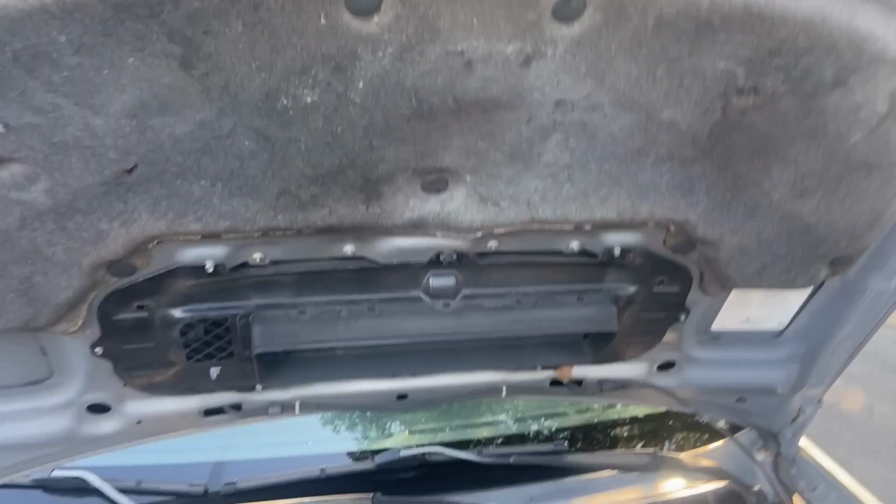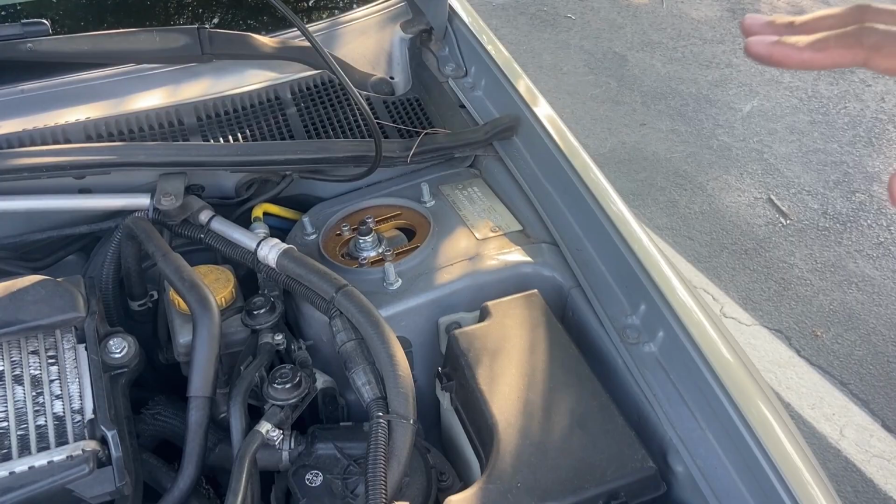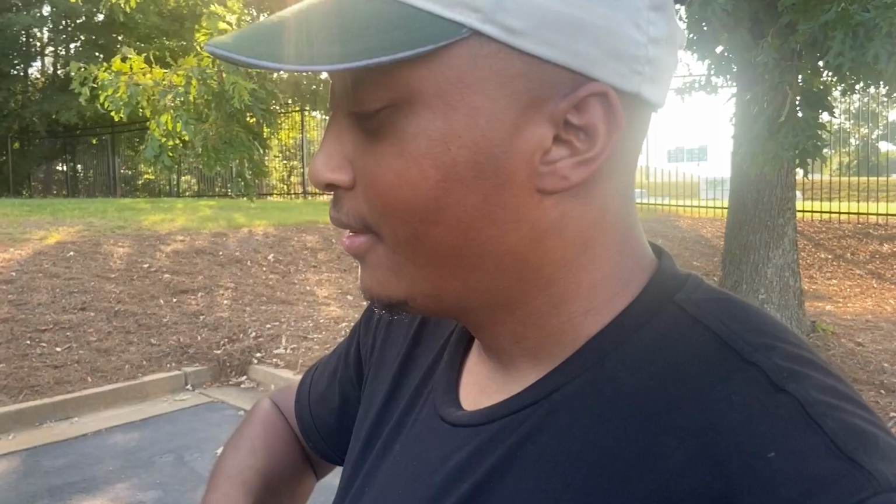Let's ask this real question. What are the coilovers? ISC coilovers. They're very great for what they are and how much they cost. It was easy to set up. They're helpful people also. If you ask questions, they answer. The fronts are adjustable for camber, in this setup, how it was with the alignment that I got at the shop. And they're 32-way, so you can set them all the way soft, all the way hard. They're very comfortable for the yard. They don't squeak as much, and they don't bounce like crazy. They're very good. All right. That's what's up, man.